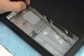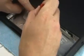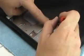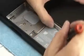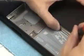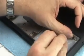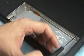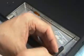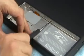The EMI RFI strips need to go down into the battery bay. Placing them in, I usually use the Phillips screwdriver to help close it and get them to tuck in all the way. Make sure they're in place before you try to put the screws in. Start with the end screw, then tighten all three Phillips screws.